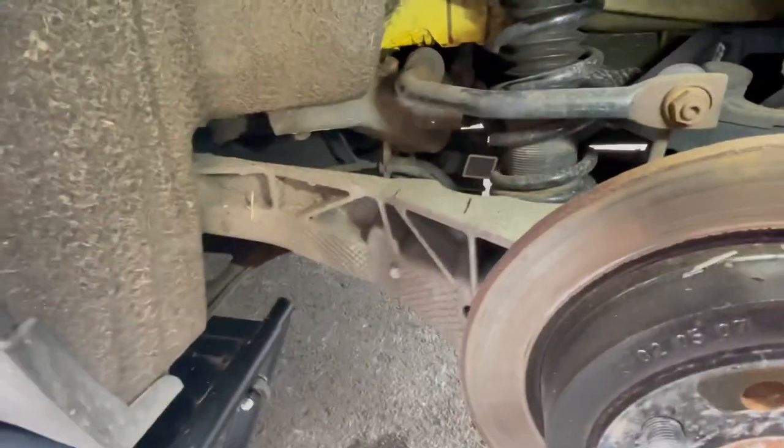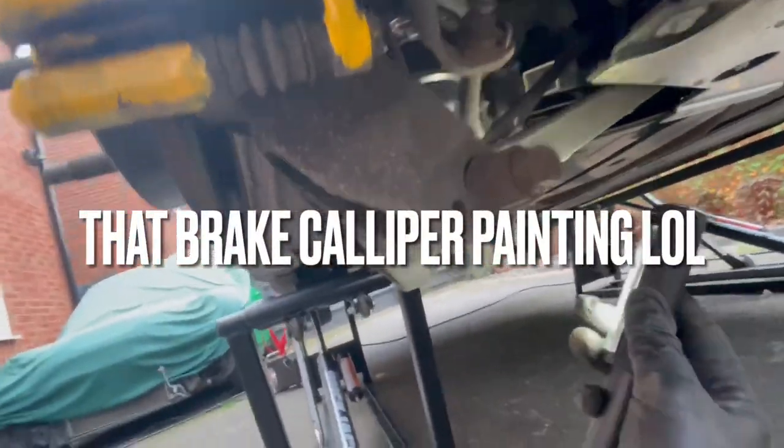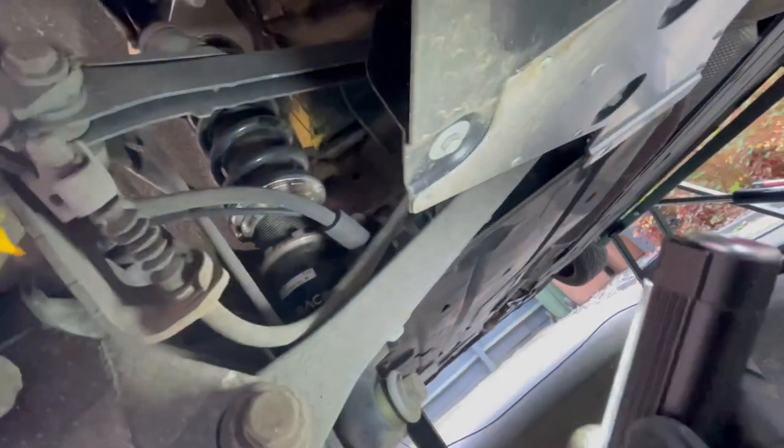Looking in the wheel arch — for a 2007 car it's not that crusty under here. It looks well looked after; there doesn't seem to be any really bad signs of corrosion. The good thing with Mini suspension, whether coilovers or standard, is that for the rears there are only three bolts you have to undo. There's one there, one up there, and then one lower one underneath the car — and that lower bolt is quite long, it comes all the way through and out the other side.